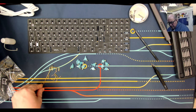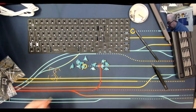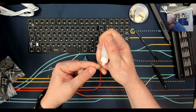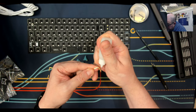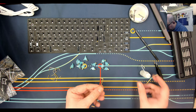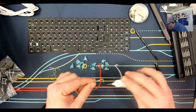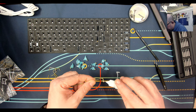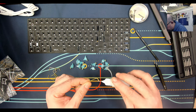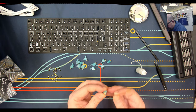So for these, I am going to be lubing them unconventionally, like I tend to do with my 80-20 mix of super lube. Just go on the stem, then use it to go all up and down, make sure to get past the elbow. Make sure it's spread as much as it can be. And then to assemble it.